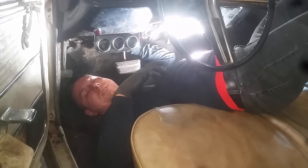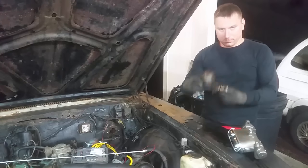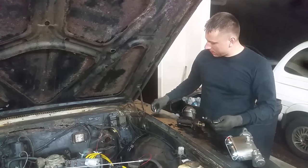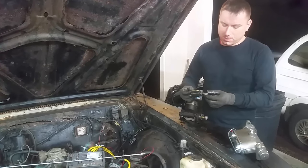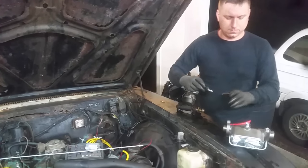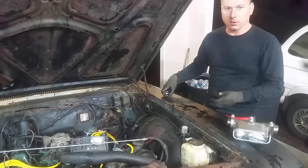Right now I'm taking out the push rod from the pedal because it's adjustable for depth — it's a pain in the butt. So this is the single master cylinder on the old, up until '68 — this is what GM used, this is what Ford used, all that. The push rod right here uses a copper washer and this piece to lock in here on this particular car. This isn't always the case, but we're just going to reuse it because it happens to work lengthwise and lock in with the master cylinder out of a 68 Camaro. So I'm just going to thread it back in to its original location after removing this clip and the copper washer.